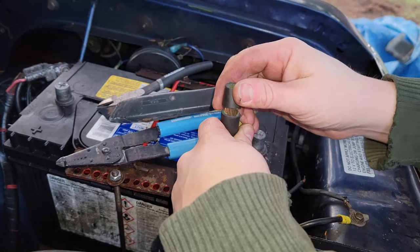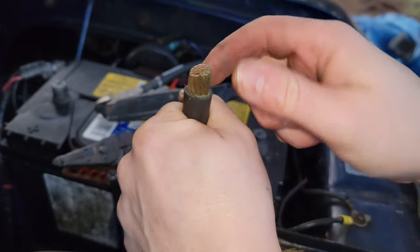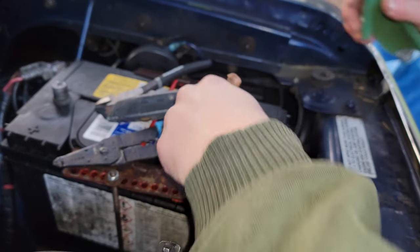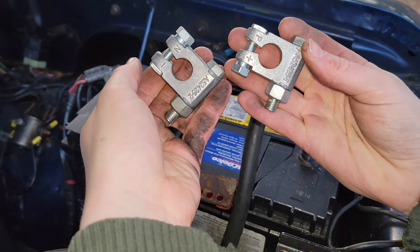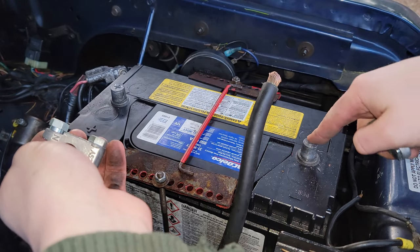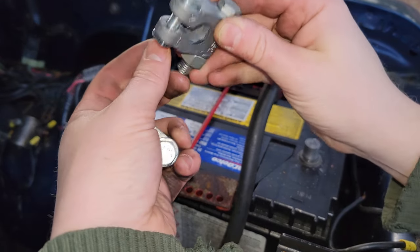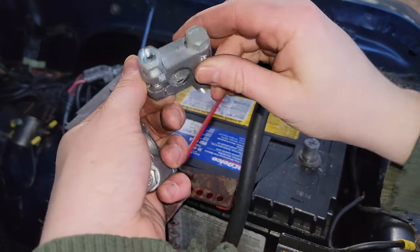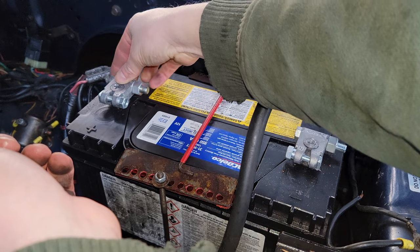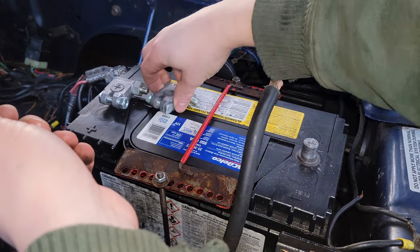Got the sheathing off. You can see a little bit of green corrosion where the sheathing meets the wire — that's exactly what we're trying to prevent. I'm just going to take a scuff pad and clean up the outside of the wire. One nice thing about these military style battery terminals is they're both labeled and they're actually slightly different sizes, because on a battery the negative terminal is slightly smaller than the positive. Both terminals are actually tapered, and the negative terminal won't fit well on the positive post and vice versa — they each fit nicely on their respective terminals.